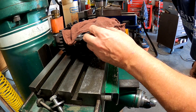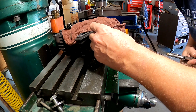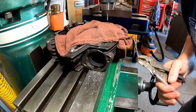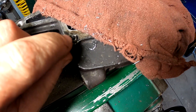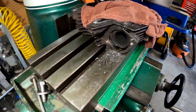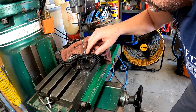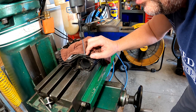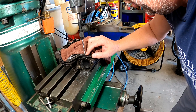That was one seized-in thread, that's for sure. I can see the minor diameter of the thread in there. If you look in there you might be able to see it — look real close — you can see the thread just starting to poke through. So this should come out fairly easily, but it's not. As I got looking in there and cleaned it up a little bit, I realized that somebody had been in here before and they JB Welded that in. So that bolt was not coming out — that bolt was JB Welded in place.